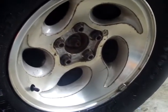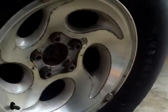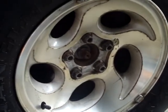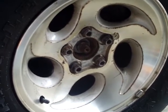Now I'm gonna show you how to do a brake inspection. First thing you want to do is pop off the cap if it has one. Next thing you want to do is loosen up all the lug nuts. It really doesn't matter what pattern you do it in.